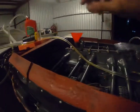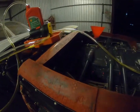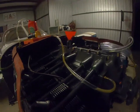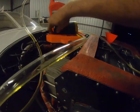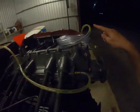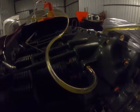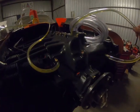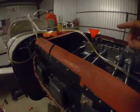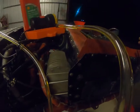So this is just pre-oiling. The service instructions have you dry crank at the end — we will do that — but for starters we're just going to put some oil in this way so we get as much oil in the engine prior to cranking. We'll run it, let it sit, let the oil drain down into the engine, do a couple quarts that way. Then we'll consider it pre-oiled, and the next time we crank over — once we get the propeller on — we can crank the engine over and prime it that way.